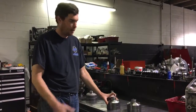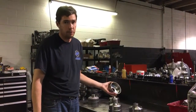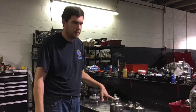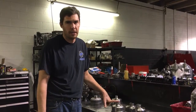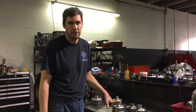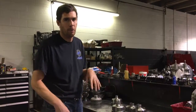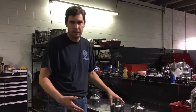These are our first revision baskets that we had made — also made in China. However, one step that we took with these is every single unit we had made, we had a Rockwell C hardness test performed on them to make sure they were in the mid-30s range, to make sure quality control didn't change, because anytime you use a Chinese company, quality control can slowly change as you order more parts. These have been pretty reliable for us, but it wasn't the best design.